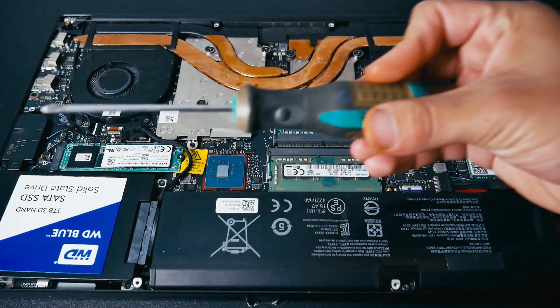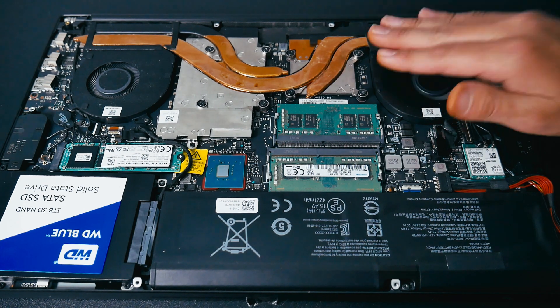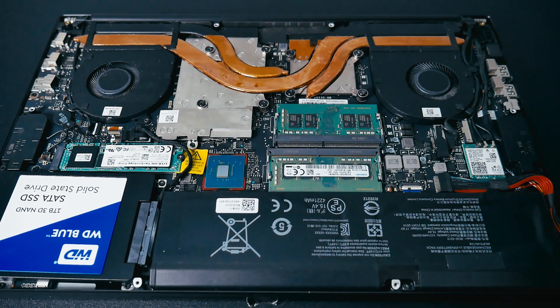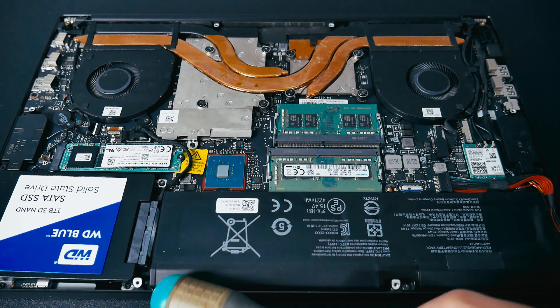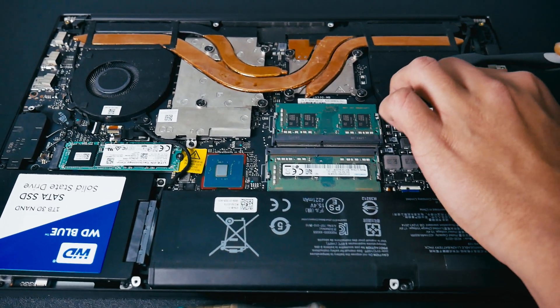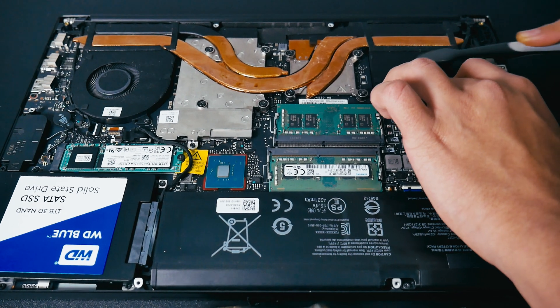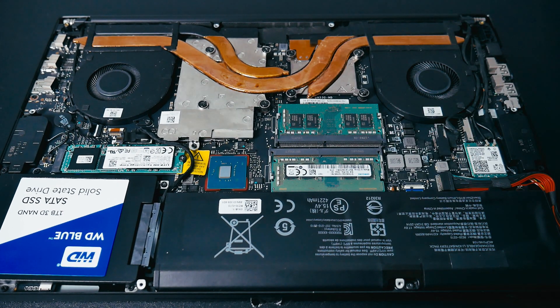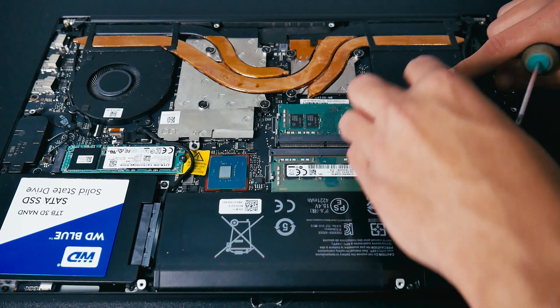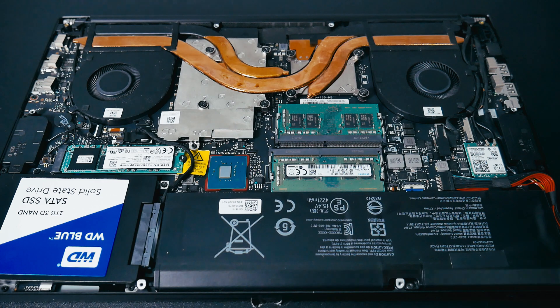As you can see there's quite a bit of dust inside already. You can grab a cloth, but personally I think the toothbrush is enough to get most of it off. Hold down the center of the fan with your finger while you use the brush to get all the dust off - this stops the fan from spinning so it's easier to clean. You can also use a baby wipe if your fans are very dirty. Once you've cleaned the surface, don't think you're done yet - you need to take off the fans themselves.